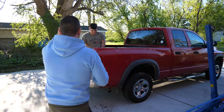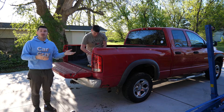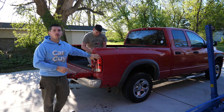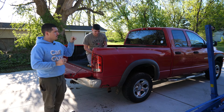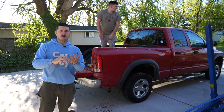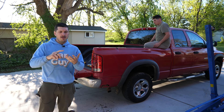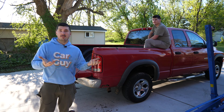We're doing a little bit of prep — Angel's removing the bedliner right now because I just really plan on selling it. I'm going to take the rear taillights out, hopefully to sell them as well, and tuck that wire back down underneath so when we pull the bed out we're not pulling any wires with it. Beyond that we should just have the gas filler neck, maybe a vent from the evap canister, the electrical, and then the four bolts — and that should really be it to come off.